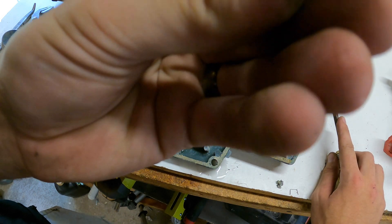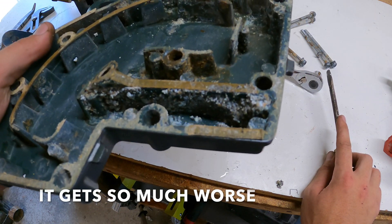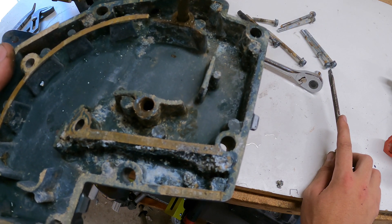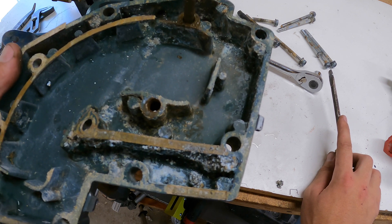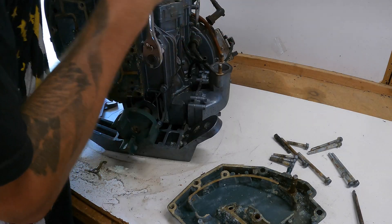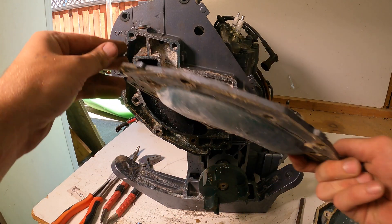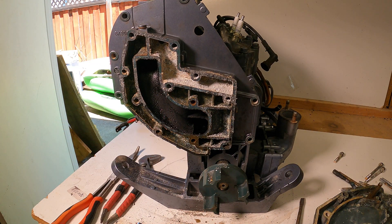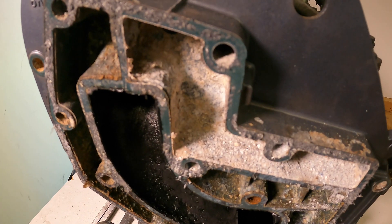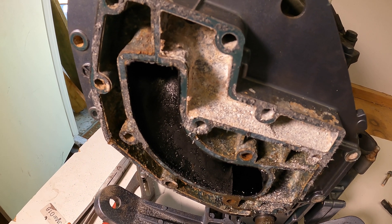It's like a sand type - seriously. I'm going to have to blow this whole cooling system out, go through everything. I just took this second plate off and there's nothing but sand in there. No wonder why the thing was overheating. That's why you don't run skis in shallow water.